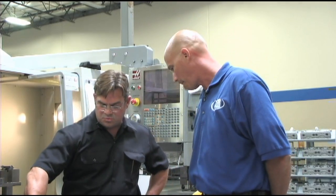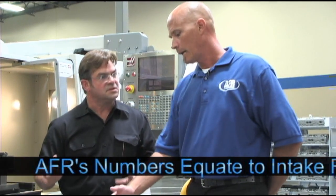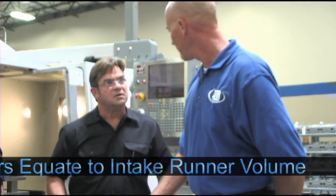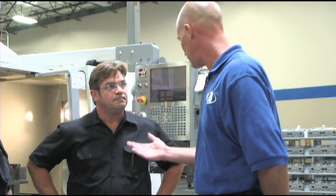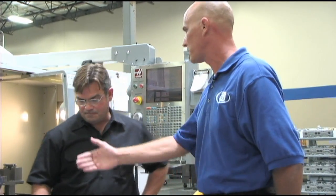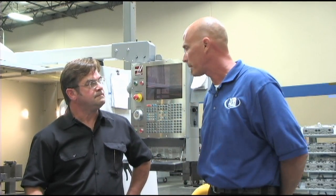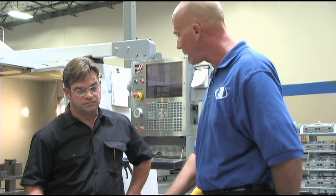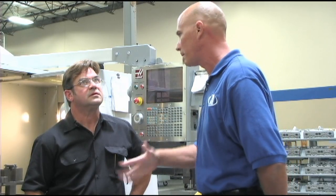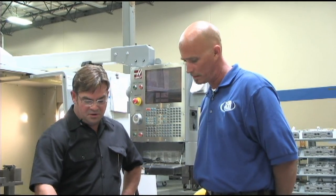When you're rolling out with all those numbers, what do they actually mean? What marks a 165 from a 255? It's actually the intake runner volume that identifies our different product lines. The 165cc's is our 165 version, and so forth. The 205 and 225 are more of your full race, hardcore application for big-time racers. The 165 is more of your OEM-type swap-out application where they bolt on and gain 25, 50, or 100 horsepower depending on the application.